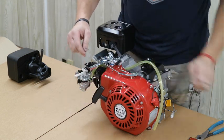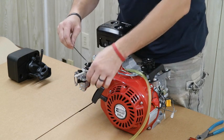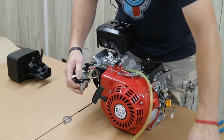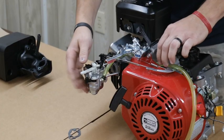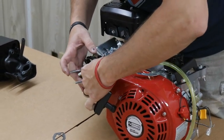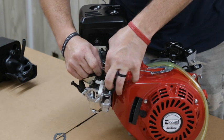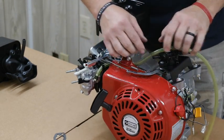A little trick: a lot of people put a sleeve over this inlet, but with the new larger barbs it's really hard to get that sleeve over it. What I do is just use a quarter inch fuel line and then use two zip ties. So far we've had no issues with that — my recommendation is to use two zip ties here because the last thing we want is a fuel leak. Pull them tight, secure, and snip them off. I'm going to pull the carburetor up snug where it belongs and route the fuel line through the same channel in the top of the insulator, just like the stock fuel line was. That's also why we like to use this premium line — it doesn't harden and it's a little smaller in diameter, so it fits right through that channel perfectly.